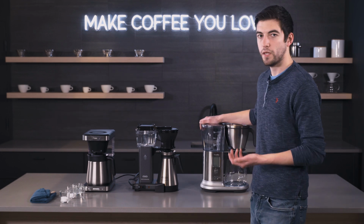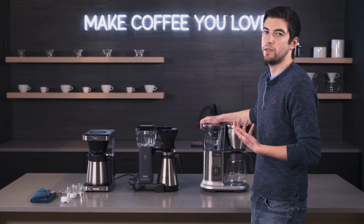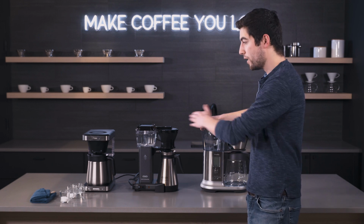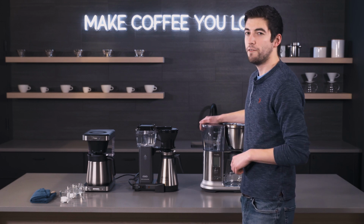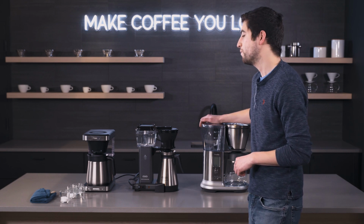For the Breville, same thing. It's generally volume-based, and with that, you do have a water hardness setting in the Breville so that the time variable changes a little bit. But with either brewer, or any brewer that suggests that you descale, it's good just to get the descale out of the way, turns that light off, gets it back to normal, and gets you all ready to brew your next pot of coffee.